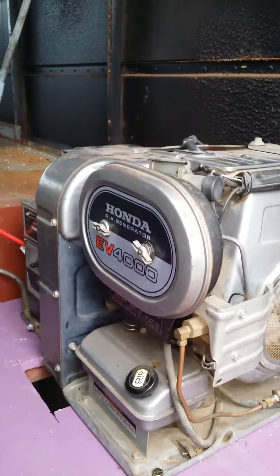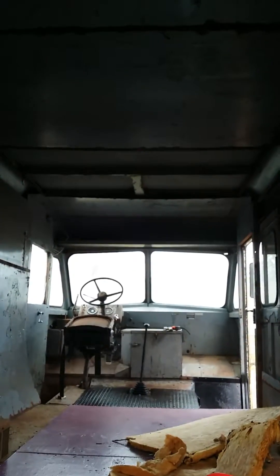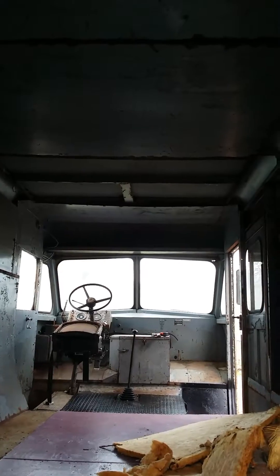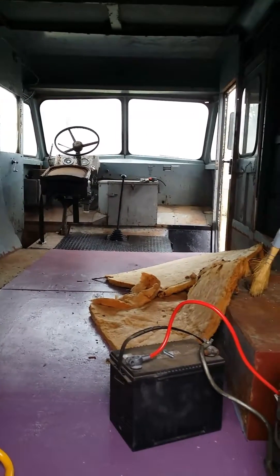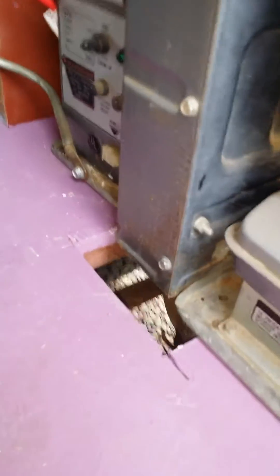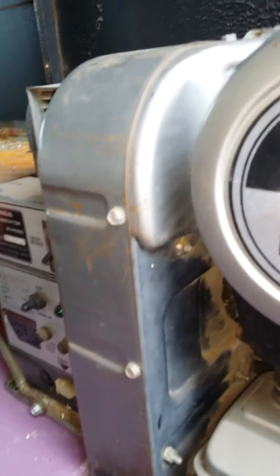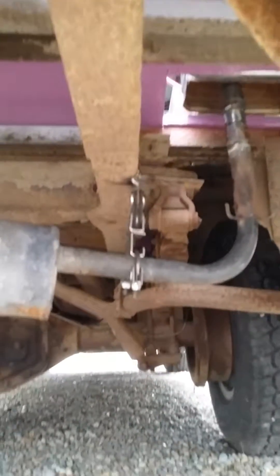My need for this is to heat and cool the van. I'm going to put a ceiling RV heat pump in here so you can heat and cool it. There's no way to do it from the dash — it would burden the engine tremendously to put an air conditioning system in here big enough. The generator exhausts all its heat down through that plenum, and the exhaust is running there. I'll show you what I did for exhaust — there it is, running through that plenum.